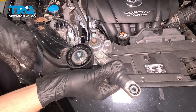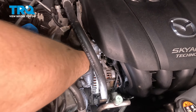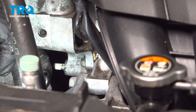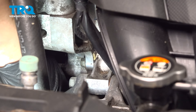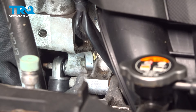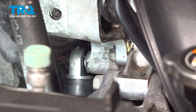Take the new tensioner, stick the bolt right through it, and put it back down into its spot. You're going to have to move it around and make it fit. Remember that slot down there — you're going to have to line that up. You can sort of see it from certain angles, but it is pretty difficult. Mine is in on the bottom. You just have to line it up at the top, which is actually the harder part. Let's clamp it on to the top with the mounting nut so it stays pretty much locked in place. Get that mounting nut started, thread it on as far as you can by hand, and then use your tool.